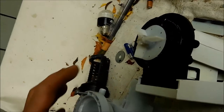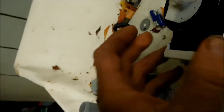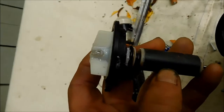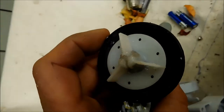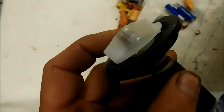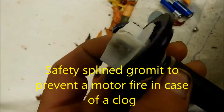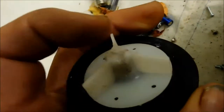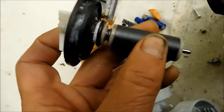If you unscrew it, make sure you remember which way they screw on because they face different angles. You probably want to get regular screw clamps instead of the pressure clamps — the screw-on clamps are easier to deal with. What happens is this impeller comes loose from the armature shaft. There's basically a safety mechanism inside this impeller — a little rubber spline grommet. When that spline grommet gets too much pressure, probably because you haven't cleaned out your filter, it will come loose from the armature shaft. It will still stay on but if you spin it you won't be able to feel the magnetic force on it.